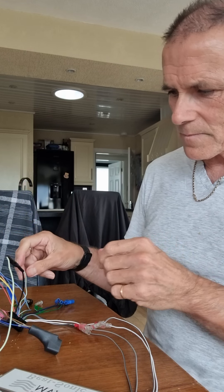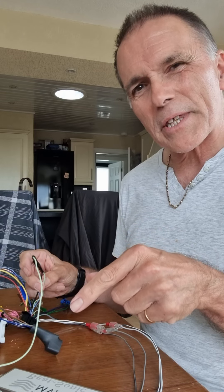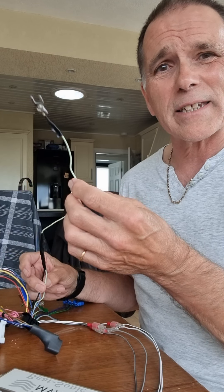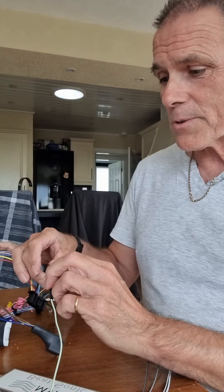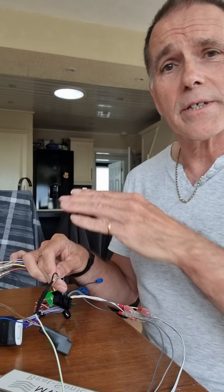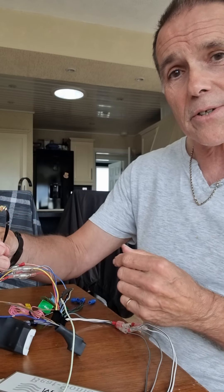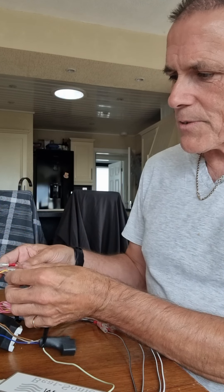There's a rather bizarre pale green cable — this is actually a safety cable that goes to the handbrake. The idea is that some functionality, like watching videos on screen, won't work if the car's in motion. I'm not advocating you do this because it's a safety feature, but I've just soldered it to the ground — the black is ground — so it thinks the car's parked and you get all the functionality of the head unit. There's also another ground wire from the Beatsonic which you'll just connect somewhere on your chassis.